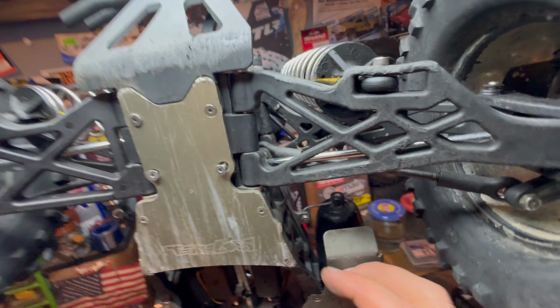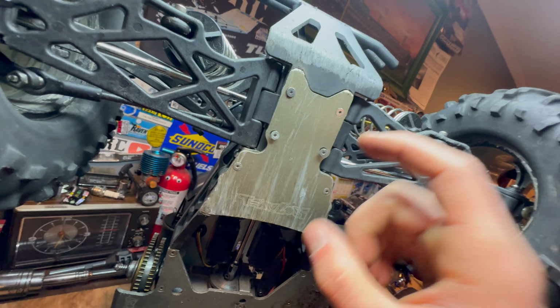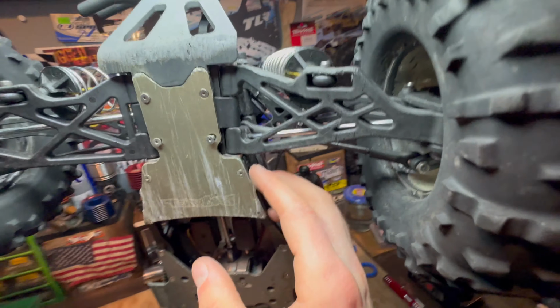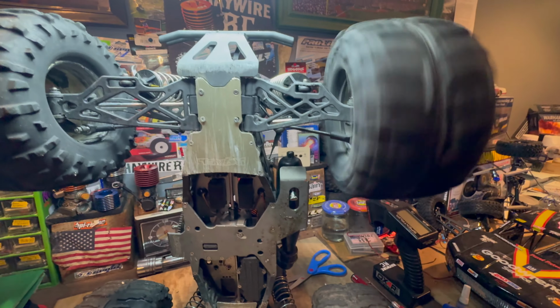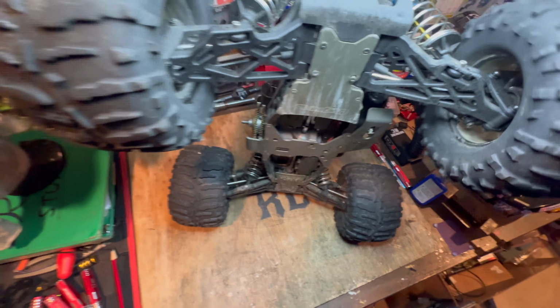Yeah guys, turns out the bulkhead just, I guess, stripped out of the screws, which is why the screws are out. And I guess the same thing with the other side. You can see the big gap. It's supposed to be flush. Also, we lost an axle too. You can just see right there, the axle is just spinning while this one's still engaged.